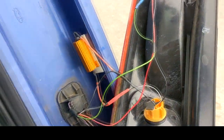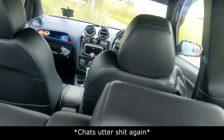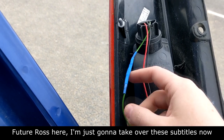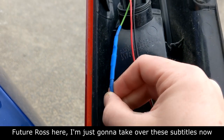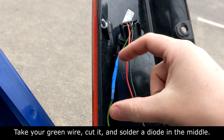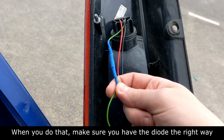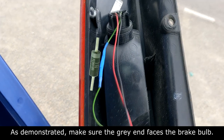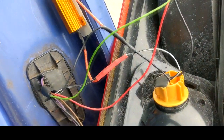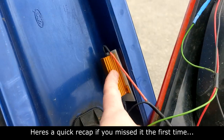For your brake light — as I said, normally when you brake it would dim the stereo. The green wire: I've put a heat shrink wrap on it but there is a diode in there. You just want to cut the wire and attach a diode in there, solder it either end. You can use electrical tape if you really want, but I'd recommend the heat shrink — it's better. The black-and-white wire and the black wire both going to the resistor, and the green wire gets the diode.